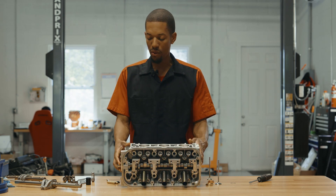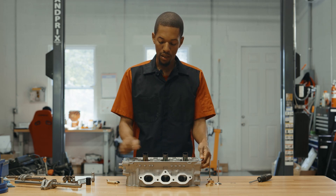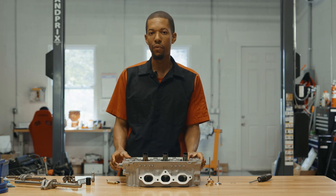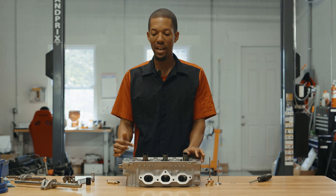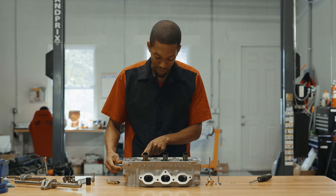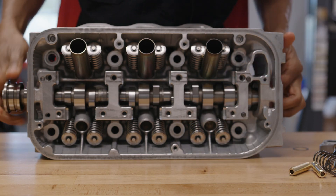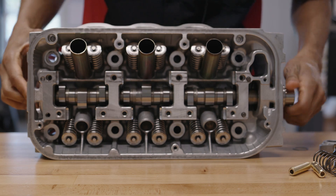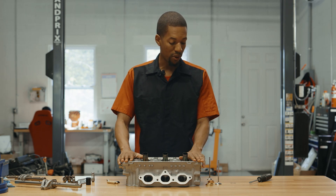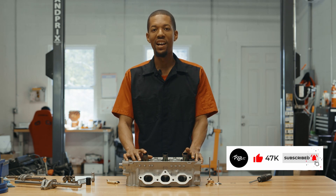I want to show you guys more about this actual camshaft from BC in the next video. This cam has just the primary lobes for the intake — the other two lobes have been ground off completely. The stock cam weighs about five pounds per cam; this camshaft weighed in at about 2.3 pounds, so we're taking quite a bit of weight off the rotating assembly. We also increased the actual VTEC lobe — this thing almost hits the lost motion assembly pocket. It's the absolute max you're going to fit in one of these cylinder heads without drilling open the bore circle or doing a line hone. I'll show you more after we do some dynos and get horsepower numbers. This is the VTEC killer cam and our CNC ported cylinder heads — thanks for watching.